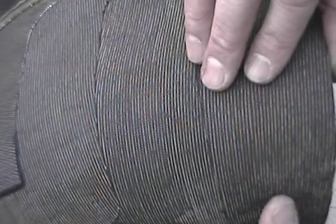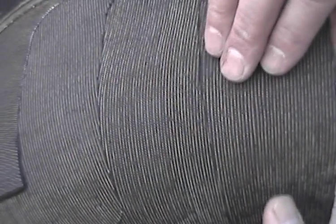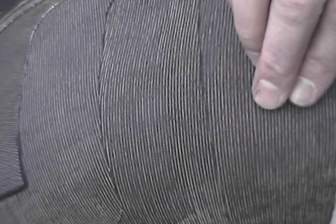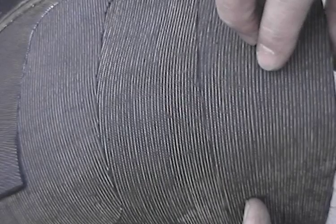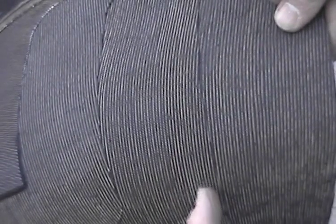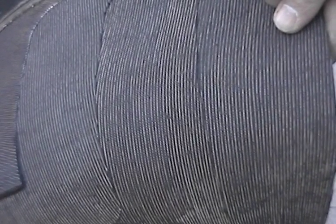This is a cutaway of the Cooper STT Armortec 3. This is looking right inside the tyre. Now all radial tyres are designed the same way today. The cords run at a 90-degree angle from the bead around the tyre, with a steel belt on top of the tyre. Now this carcass is where all the damage happens. If you notice that where the 2nd ply overlays, it runs at the same 90-degree angle. If it was a 3rd ply, it would run at the same 90-degree angle.